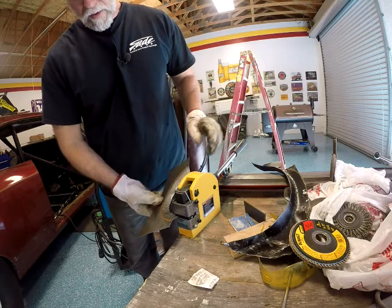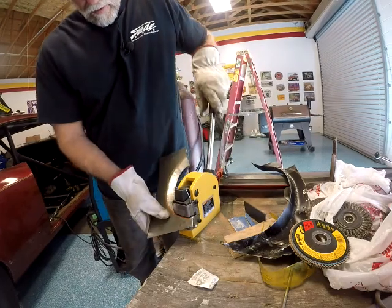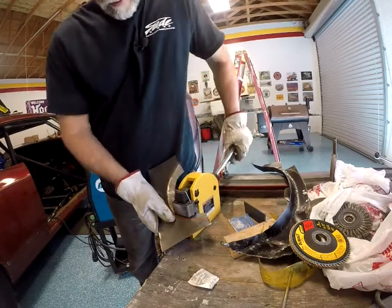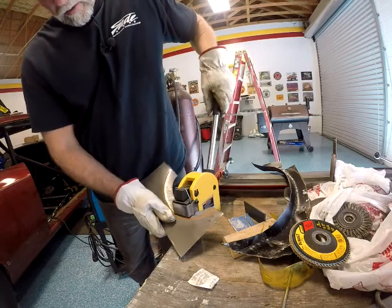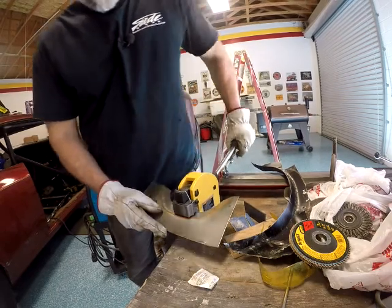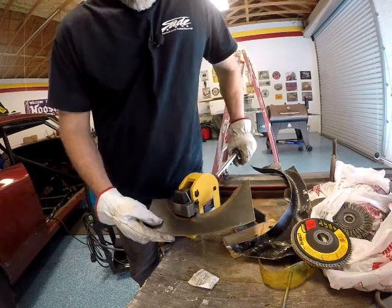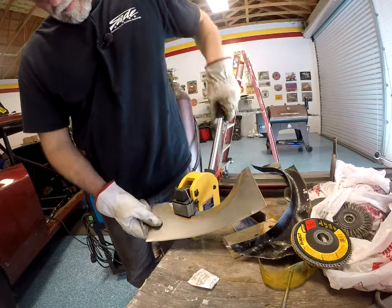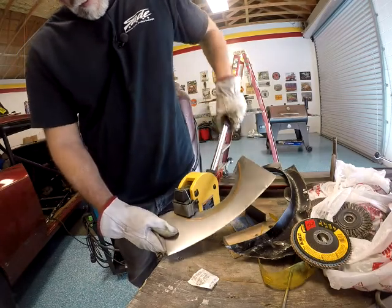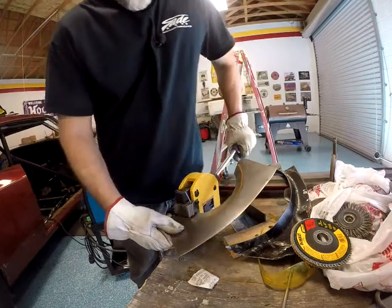The thing that I realized with the little stretchy tool here is it gives you like a 1-inch flange perfectly as you put it in there. And you just keep working on that metal. Now it does leave little marks in it that I wasn't thrilled about. But hey, you've got to take what you get sometimes. You can machine and sand some of it out, but don't be too worried about it. Later on, I make another piece that goes over the flange that I actually made, so it covers all that up, and it's all covered by the tunnel cover anyway, so it doesn't really matter.